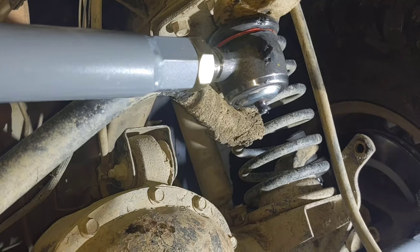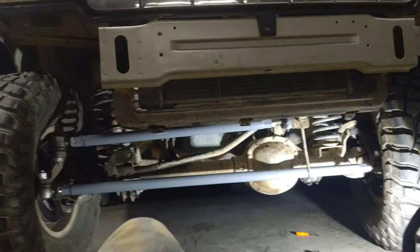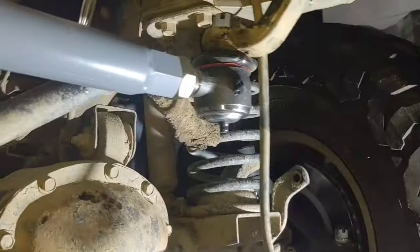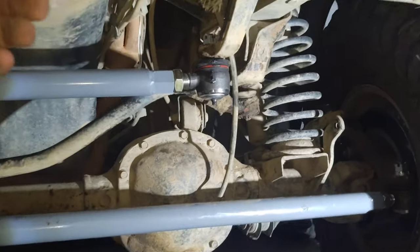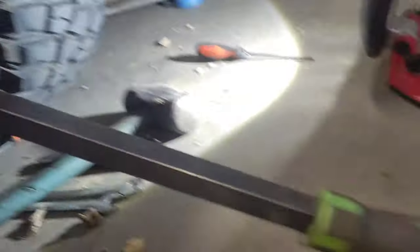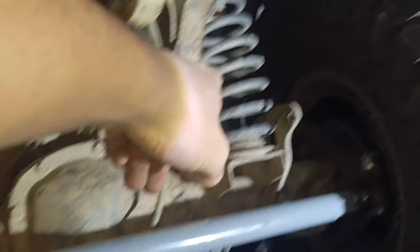That's loose - I think the actual taper part is loose. If I wiggle the steering wheel it might fall down, because right now with my lift it's got it in a little bit of a bind since it's not sitting in its neutral spot. I stuck my pry bar right through here and kind of pushed it up, then tapped it in with the hammer - not crazy hard, just pried down a little by pushing the tie rod and then smacked it with the hammer.